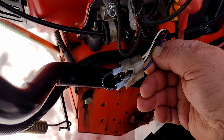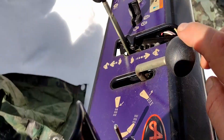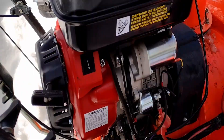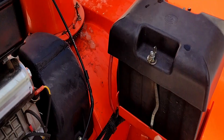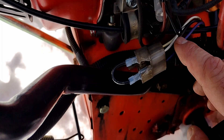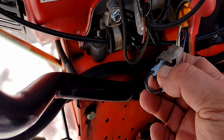This wire goes up to the switch and then has a fuse and comes back over to the battery positive. So this wire is ideal for getting power back into the hand warmers and the headlight, and what I did was just looped a wire around to feed the 12 volts back into the headlight and hand warmers.